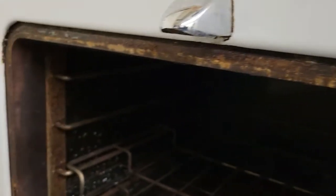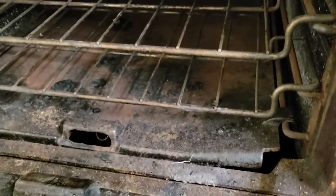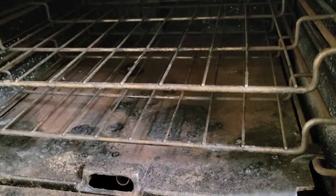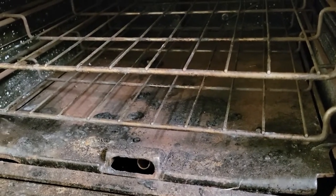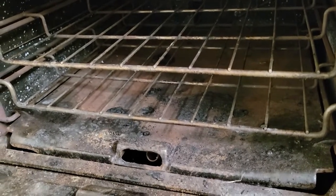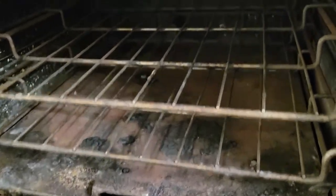As you look around the oven, it is normal to see the oven doorframe bronzed — it was originally painted silver, and over time the paint gave way and the cast iron doorframe seasoned into that bronze. You can also see the oven floor has seen better days — there's a lot of wear to that enamel, making it a prime candidate for seasoning. If you prefer a shiny black enamel, you can re-enamel it as well. Personally, I find seasoning cast iron parts that have worn out to be a more cost-effective and longer-lasting solution, because the original enamel gave way — seasoning will not. Either way, I know this can be fixed.